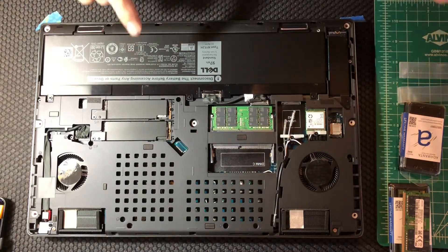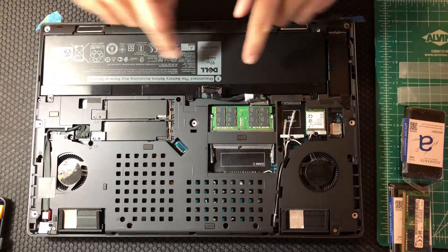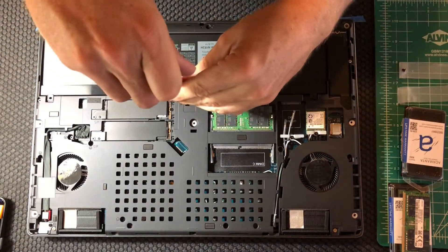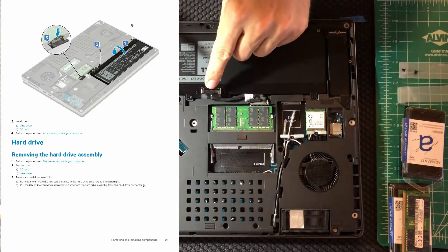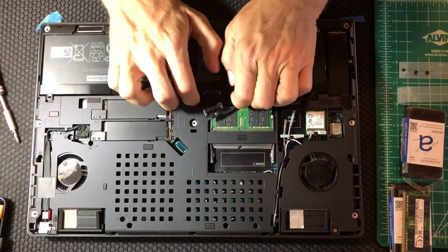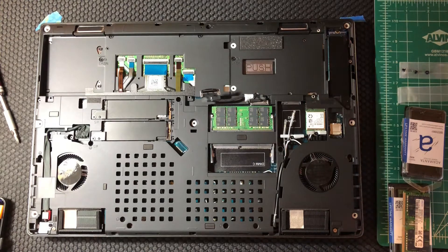Before you do anything inside, you're supposed to remove the battery. You pry up on the release loop and it disconnects the battery electrically from the system. You also have to take the battery out of the machine using these three screws if you're going to do anything with the keyboard panel, because the keyboard panel has ribbons that run underneath the battery. If you're just adding a RAM chip to the underside, you can stop with the electrical cable removal. But since we're installing a piece underneath the keyboard as well, we need the battery out to disconnect the ribbons and pull them through to remove the keyboard from the other side.